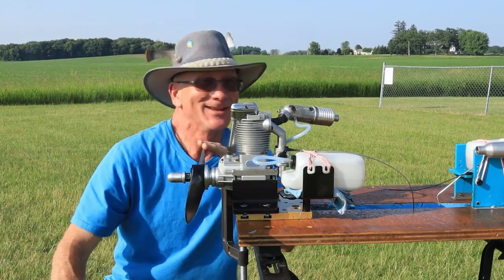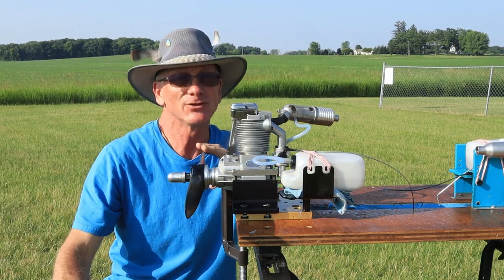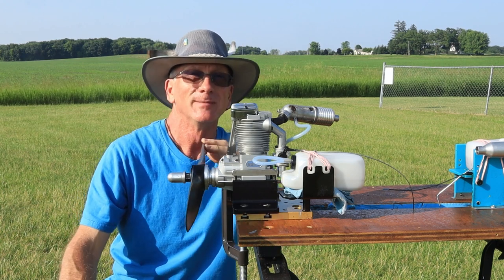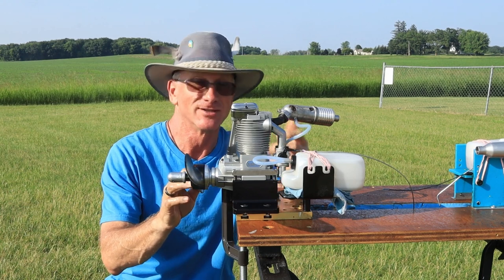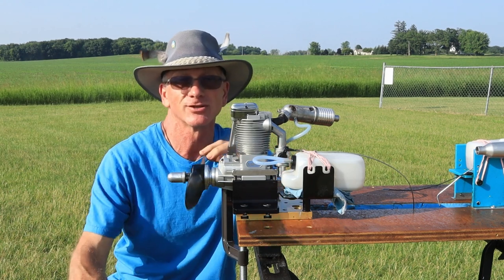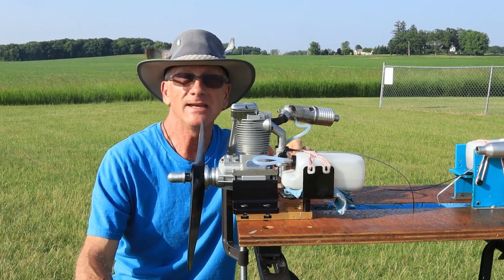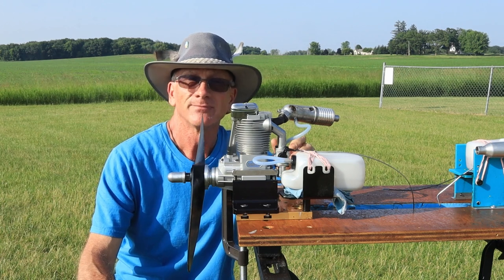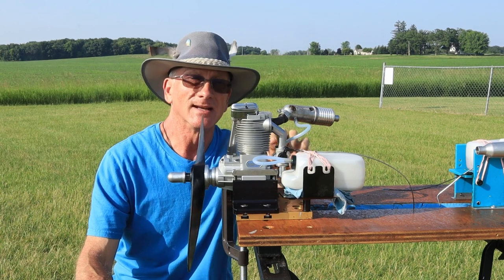Okay, so that was a fantastic run. Now, the thing that I thought was really interesting about this run, and I'm not sure if there was something I was doing wrong or what, but as I said in the intro, I opened the needle valve for priming and starting per Saito's instructions. And right away when I was tuning it, it hit a really good peak of over 8,000 RPM. But then after that, it didn't seem like it wanted to hit that same peak again.